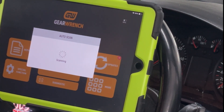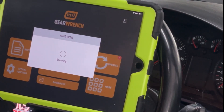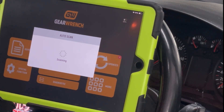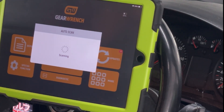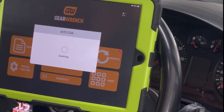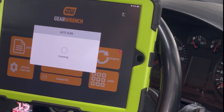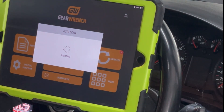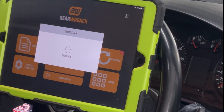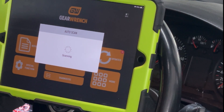It's going to sit here for a little while and then pop up and say it couldn't find the VIN — even though I know it can read the VIN. So I'm going to have to get up, find a VIN plate up front, and manually type it in after waiting two minutes for it to ask me. By the way, I scanned somebody's Suzuki X90 the other day and it wouldn't do it at all — it just sat there forever, wouldn't even prompt for a VIN. That was a '96 vehicle, so it should have been OBD2 compatible.